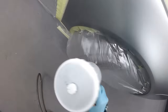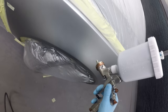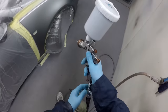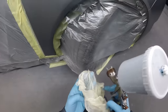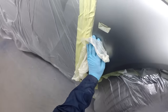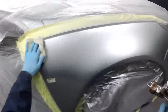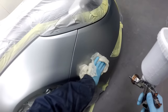Even once I've put all the coats of base down and finished my blends, when I go out of the booth to mix my clear coat, I'll come back in with my fresh gun, set it to two bar, and give the area a good tack — including where we've painted. Between coats I use the air from the spray gun itself to dry the base coat down and speed up the process. The only thing I've cut out of this video is about 60 seconds of blowing the car down — you don't really want to watch me waving air at a car.